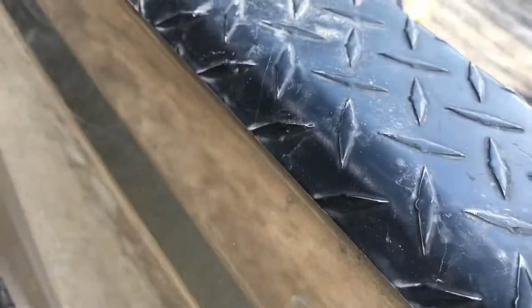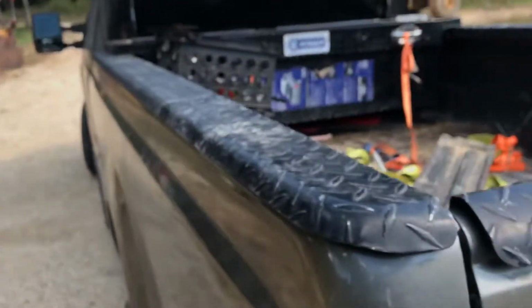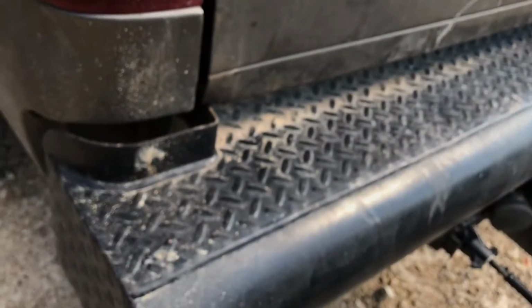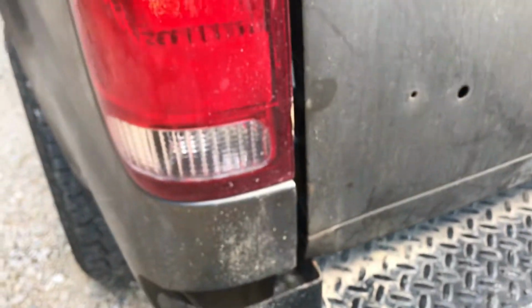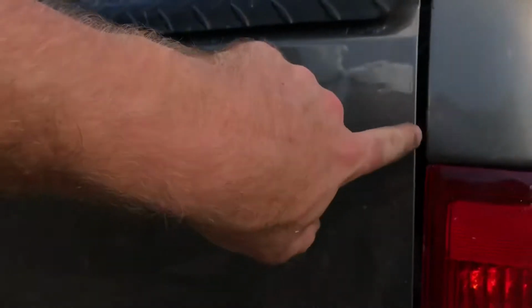I found another one of these little stogs. Well, I thought I did. I can't find the original one that I had. Anyway, that little rubber plug that I showed you, and then the two bushings, the two little shims that were in there, I took all of that, stacked it in there, and that's enough that now the tailgate doesn't want to wobble back and forth at all. And when I folded it up, it readily latched in here instead of jamming beside it.